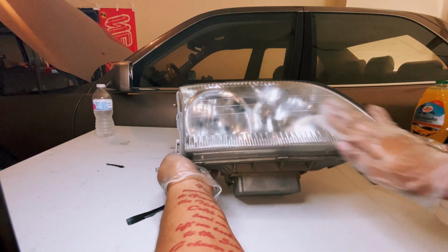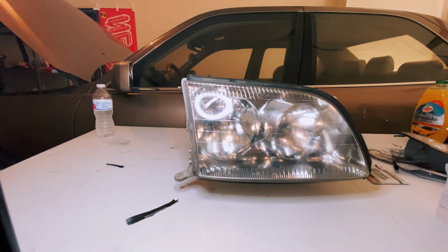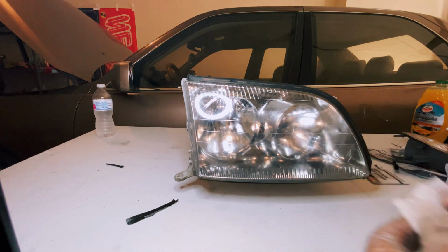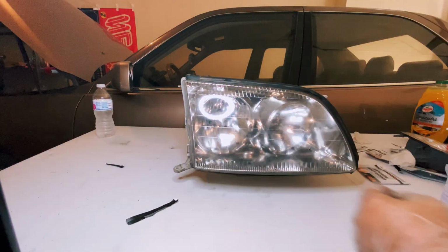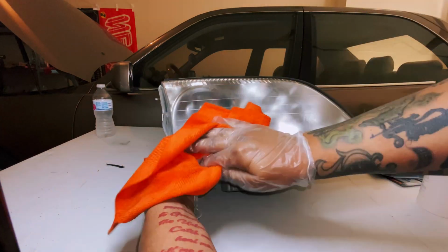And these cloths are a bit abrasive, so helping on that surface, breaking down that oxidation. You are going to see on each pad, it does leave a little bit of yellow. That is that oxidation coming off, and natural. You do want that. You should use all 4 per each headlight. I saved 1 for my side markers. After that, rinse it off, dry it down.